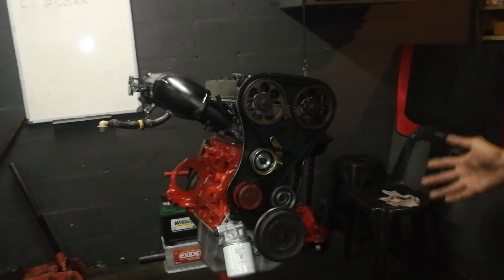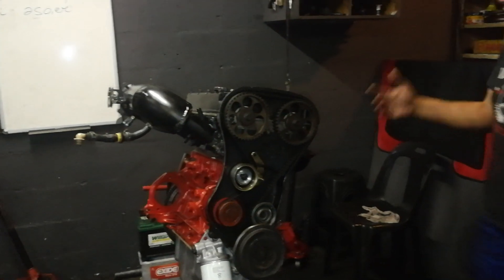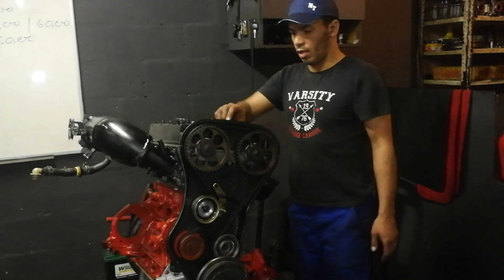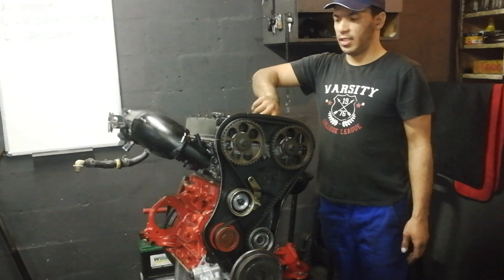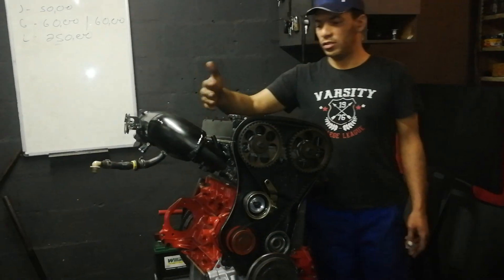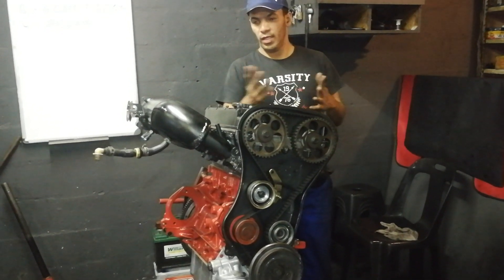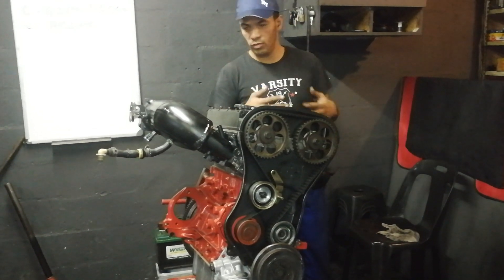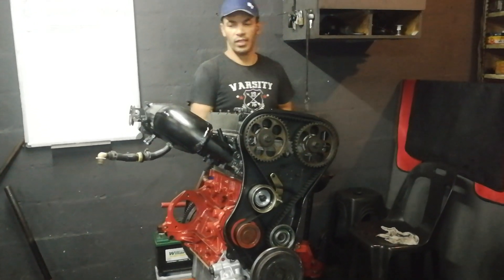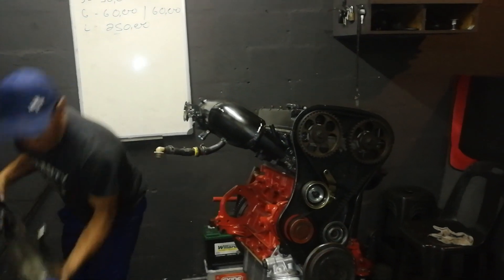The turbo still needs to be done. It's going to go GT30 or GT35 depending on the motor application and what power we're looking at. We're going to change the injectors to 440cc's, or depending on the application about 680cc should be fine. 440cc is fine depending on what boost you want to make. And just a charge cooler.